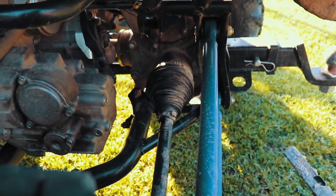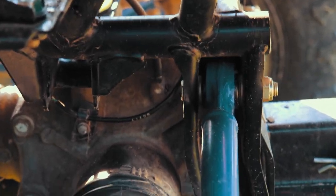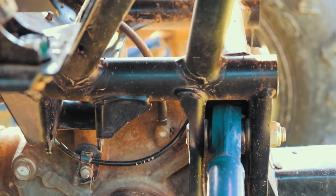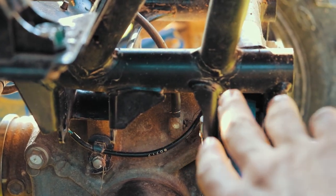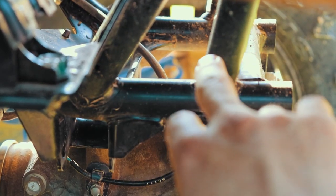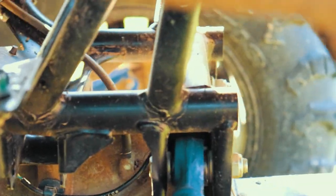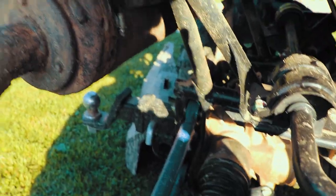Not really. All right, well, so this is the driver's side here. You can at least see where the vent line goes in, okay? That's gonna be the vent line we're talking about right here. But when it's ran OEM style, it's actually connected on the passenger side. So if you just find this tube, follow it up, you'll find it to the barb. I'll show you where the nipple is. But if you can find them, it becomes real easy.